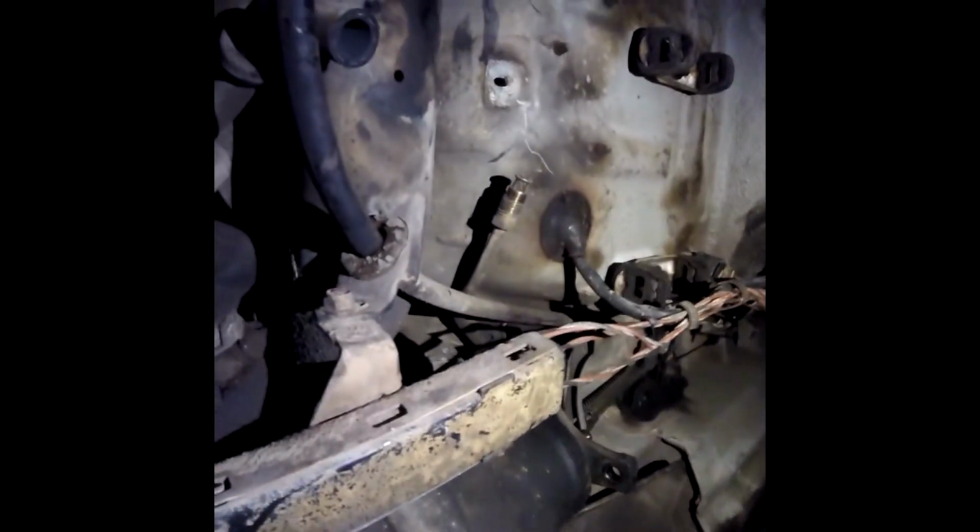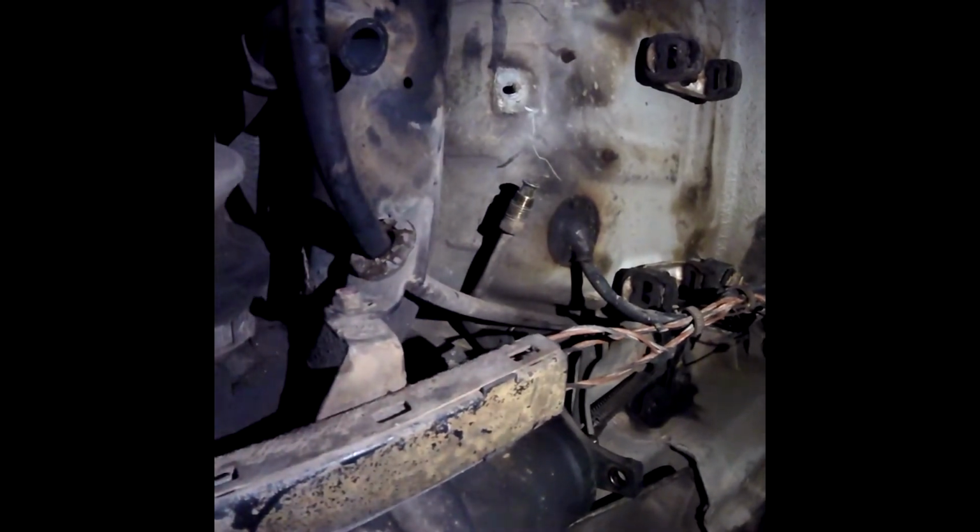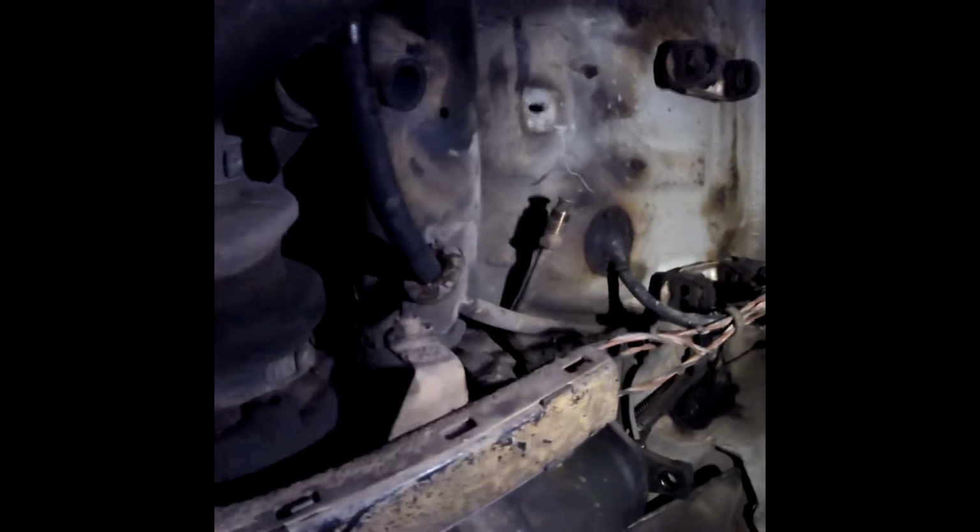The North Carolina car, so I mean it's cherry underneath, completely cherry. But I'll show you how this, I guess, look at the Barrett-Jackson undershot. This fuel line, here's where the whole fuel setup was, and it has a dual pump hanger setup with a filter and an accumulator. I'm trying to retain that, but I'm also trying to use the factory fuel lines, which are in here. That's brake lines and fuel lines. I cut this here. That's the return. It's a return fuel system type, which is identical to the 2JZ. And then here would be the feed.